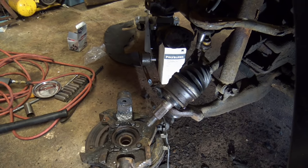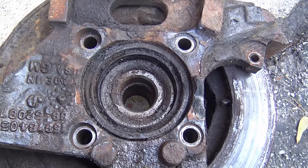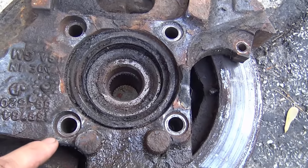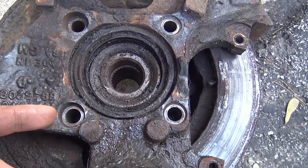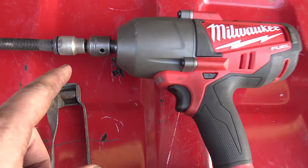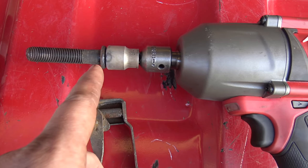That's the way to get to the back bolts on the hub. These tend to stick in pretty good — the threads and the bolt themselves are not bad but the head is what gets seized to the knuckle. We cleaned it out really well with rust penetrant but it didn't work; the heads were rounding off. This is a plow truck, so we had to use an extractor set. Even that would round off — the bolts have very small 15mm heads and you have to have the special bolts from GM to fit in the recess.